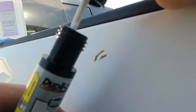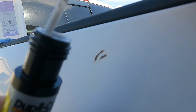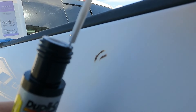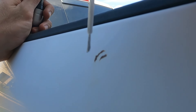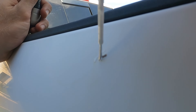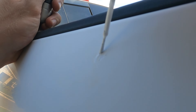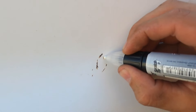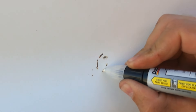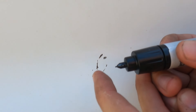I'm going to wipe that down and use the brush on this one. Watch for any drips as you're applying it. Also know that it tends to dry kind of quick, so if you're not careful it'll get some little strings that come off of it. This one's pretty deep so I'm trying to build up the paint just a little bit. I'll let that dry for 30 minutes — it's not going to be completely smooth but it hides the scratch pretty well.